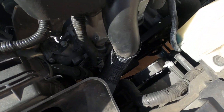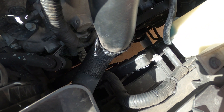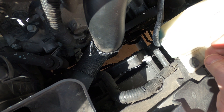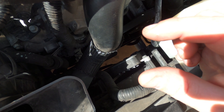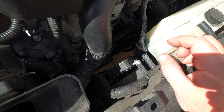The oil filter is pretty easy to get to — I already have the engine covers removed from the bottom, which makes it a little easier to see. That's the oil cooler right there, and that's where the oil filter sandwich plate is going to go so we can run our pressure lines to the cooler. That oil filter may or may not work with the sandwich plate because the plate is about half an inch to an inch thick, so we might have to source another oil filter.